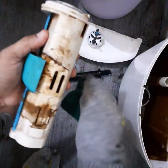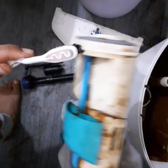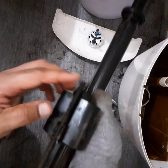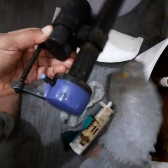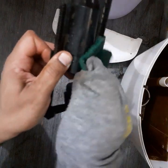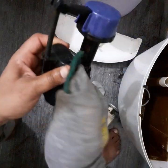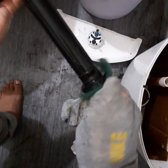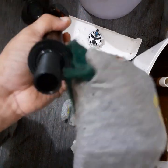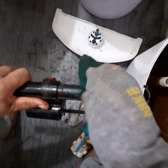Make sure you use either a soft brush or something if you feel the dirt is in areas where your hands are not reachable. Similarly with this one — you will see a lot of salt deposits inside; we have to scrub them so that the flush fills and clears smoothly. The whole cartridge should be scrubbed, and even this rubber — wherever you see salt deposits, scrub it and rinse it with flowing water.